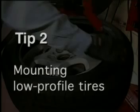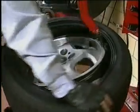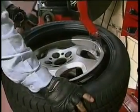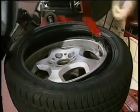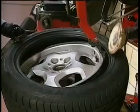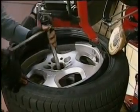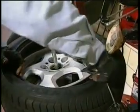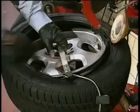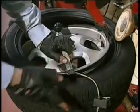First off, the tire is always on the left-hand part of the mount head, and the tire is also on the right-hand lower part, but sometimes that's not happening automatically. So you have to use some method of getting the bead below that location. So as you see here, the roller holds it there. The next step, the third step, is getting the bead locked to the rim. And sometimes that doesn't happen automatically, so that's the purpose of this bead depressor tail. It locks the bead to the rim, and the last step is to get the bead in the drop center.